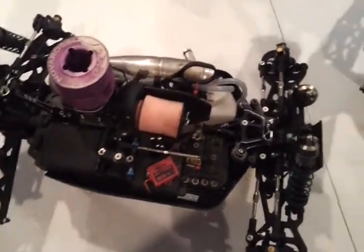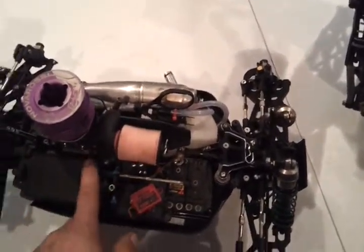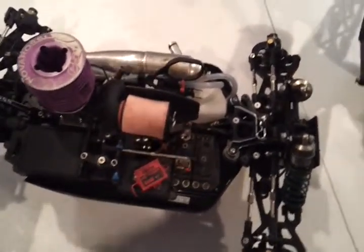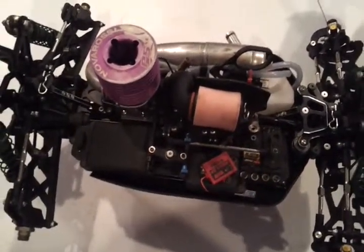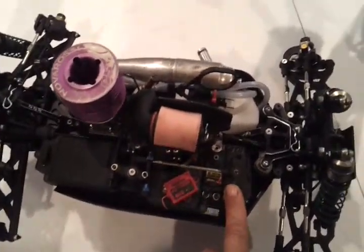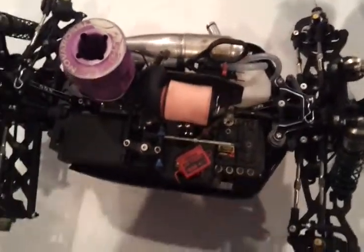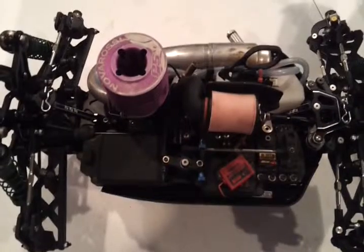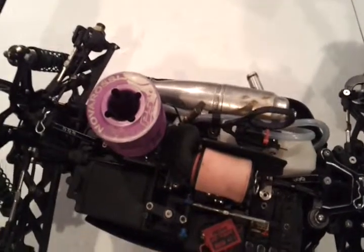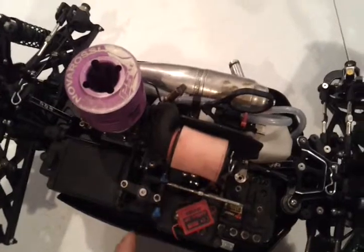I strongly recommend this. There was a problem — I'm sure most of you are aware — where the servo was next to the engine and it was popping servos quite often. I think I had one issue with it, and this was long before they had the Gen 3 radio tray. They moved the servo up here for the throttle and they got this linkage. When you put this together, follow the instructions as close as you can and make sure all your adjustments are just about to the T. There are a few marks you've got to line up to make sure the adjustment is correct.